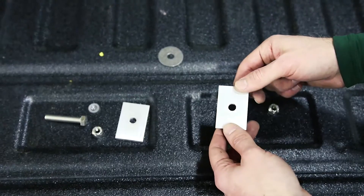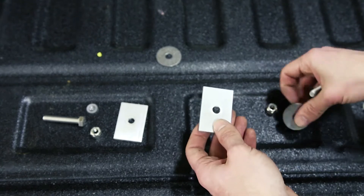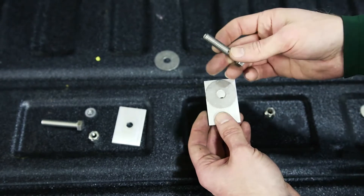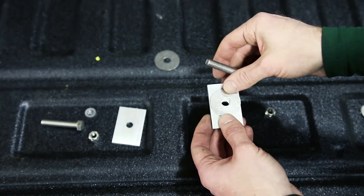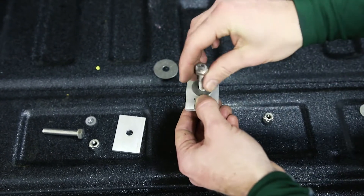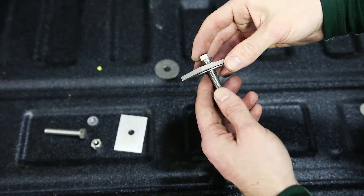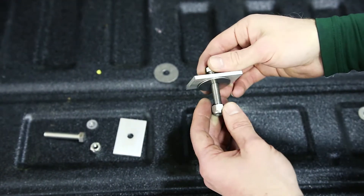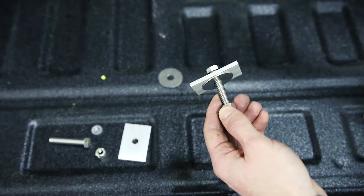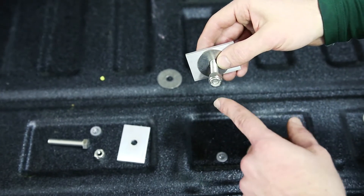Because of the way we installed the stake pocket tie-downs, we didn't need to use the included metal plate, so we're going to reuse it for the second mount. I picked up some additional washers and coarse-threaded 3/8 bolts — this goes up underneath the bed rail. We'll mount the bolt down through the top and put a locking nut on the other end. The nice thing about this configuration is it's much harder to steal your rear rack, because it's mounted underneath the bed rail with no way to access it from the bed — you'd have to either remove the tail light or access it from underneath.